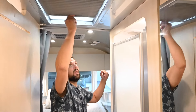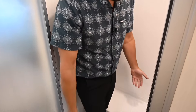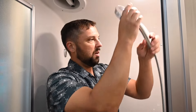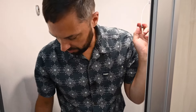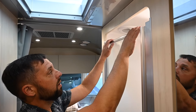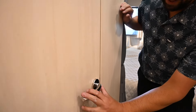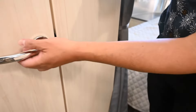The skylight in the bath area has a film on it so you can see what you're doing. The shower has a glass door with a magnetic strip latch, a light, and is all fiberglass in two pieces going all the way to the ceiling — no need to worry about getting wall material or a curtain wet. There's a premium shower faucet fixture with a residential shower diverter for hot and cold. There's a clothesline in this compartment and a drain plug for the shower floor that you leave in when towing. The bathroom fan pushes up at the top with a gap at the door to get more air volume through. There's also an access panel to get to the plumbing and drain if needed. The door latch is magnetic with no protruding piece — as soon as you close the door it locks securely.